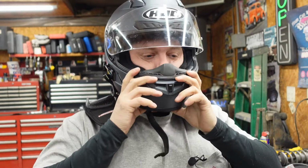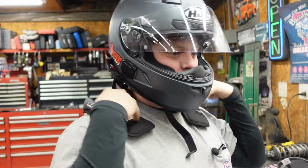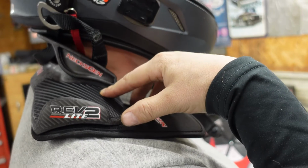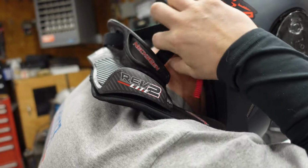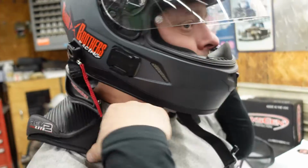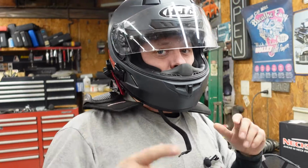So there you go. Hopefully you can still hear me with the mic, because this is where I'm talking about the adjustment. Your seat belts are going to be over top of this area right here, and it's going to be tight. What this is meant to do is keep your head from hyperextending. If I go as far as I can go by itself, I still have some slack in this line right here. What I have to do is tighten this up. The good thing about Necksgen is they make it really easy to adjust that, and I'll show you.